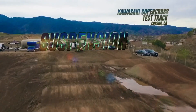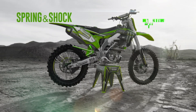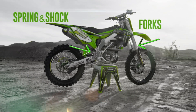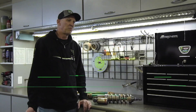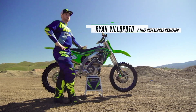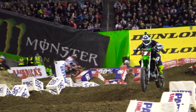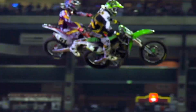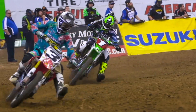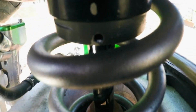The most important thing on bike setup is suspension — the shock absorber and the front forks. The job of those components is to absorb the bumps on the track and absorb some of the jumps that the riders hit. Supercross suspension is uncomfortable, very stiff and not forgiving unless you're going at racing speed. An example of that would be like taking steel bars, putting them where the forks go and a steel rod where the shock goes — that's what it would feel like, a very jarring ride.